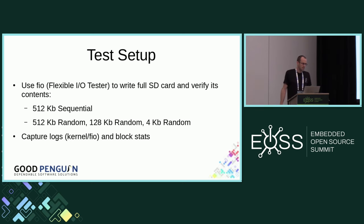We had to estimate the expected life. We have an 8GB SD card, and MLC should be able to do around 3,000 program/erase cycles. If we write the entire card once, we've probably programmed and erased each MLC NAND cell at least once. Multiplying the two together, we estimated around 21 terabytes before things start going wrong. This TBW — terabytes written — metric aims to describe the life of flash memory. It's also worth noting that manufacturers express endurance or lifetime in different ways: some as video recording capacity, some in TBW, and some just talk about the number of cycles the underlying flash can do.